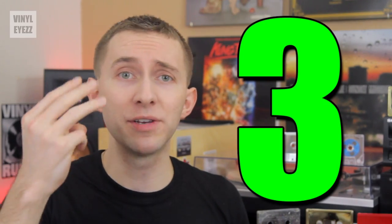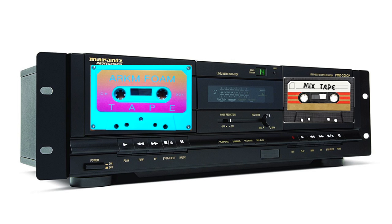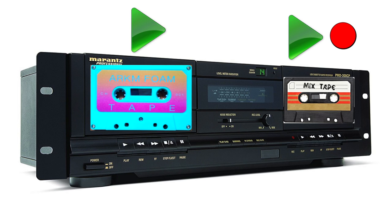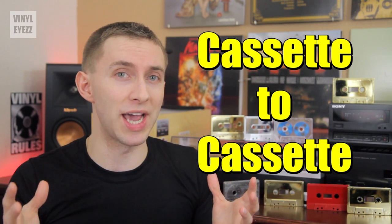So there are three main ways to make a cassette mixtape. The first way is by using a simple dual cassette deck, which is a cassette deck that has a cassette well on the left side and also on the right side. You queue up tracks on the left side, then hit play on the left cassette and play and record on the right cassette — and then the right cassette becomes your mixtape. That method is basically going from cassette to cassette using the same deck.